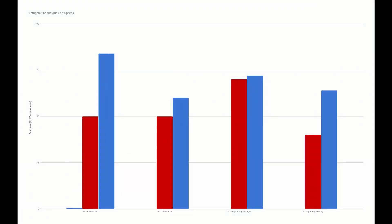With a typical gaming load, I'm running the card at 120% power limit, no extra voltage, clock speed boosted by 150MHz on the core and 400 on the memory. With those settings, I've never seen temperatures during gaming go past 65°C, and I've never seen the fans go past 42–45%. Bear in mind, this is also at 4K — I'm driving a 4K display, so the card is really getting hammered. Loading the bus, loading the memory — I was playing Shadow of Mordor and got up to almost 10 gigabytes of VRAM usage. We're really hitting the whole card and it's performing excellent.